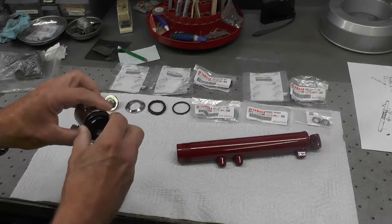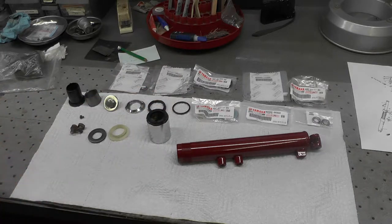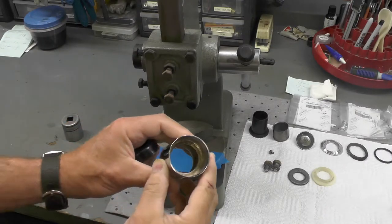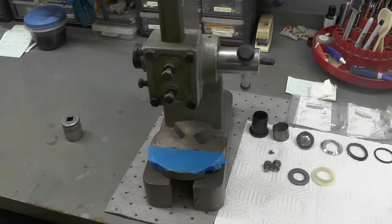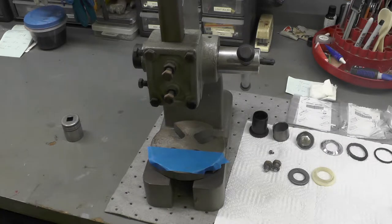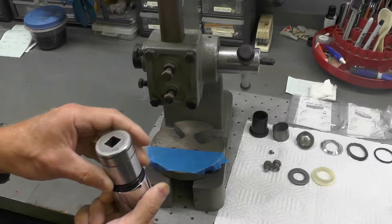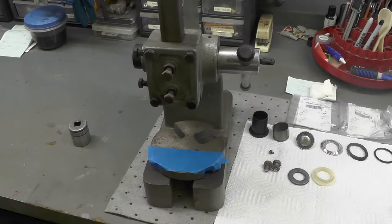You may recall that this is a seal I had to find a replacement for — the original is no longer available. It had a metal band around it, and Roy UK mentioned or found a new version of that. I had already purchased this vinyl seal. We're going to set up to install the fork seals. I'm going to do both the left and right nuts at the same time since I'm going to be using my little arbor press. This seal goes into this nut in the cavity right there, gets pressed down. You don't have to use an arbor press — you could use a bench vise large enough to capture this width, a socket and mallet with a block of wood — many ways you can go about it. I'm simply going to use the arbor press because I have it.